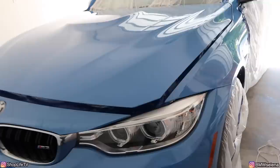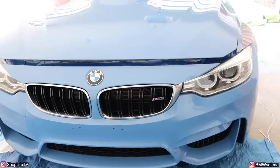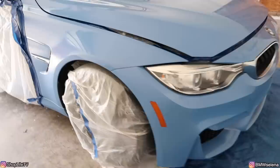This side came out really well because it was more lit up. I had better lighting on here, and I also had more space. And then another thing you want to do is if you have some areas taped off, make sure you take the tape off of that, just that one area, while it is still wet. All right, let's start unmasking.